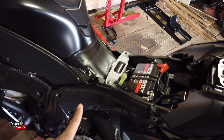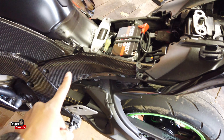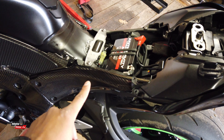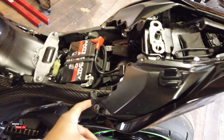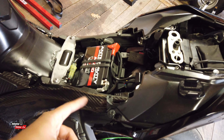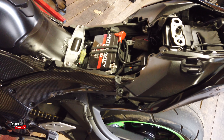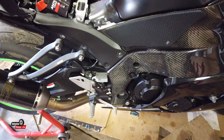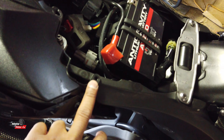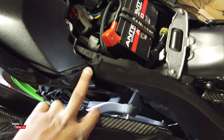Just to let you know, you also have to take out this bolt as well. This bolt came out from right here - that's how you can move this back piece back and then slide the subframe cover in there. Be sure not to force it in there because this piece is very, very thin and very delicate. You don't want to snap it in half. Make sure you have enough wiggle room to sneak this piece in so that it fits nice and flush.